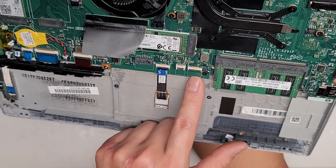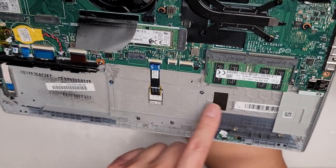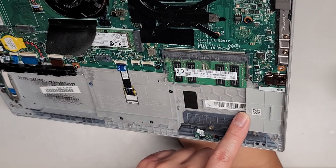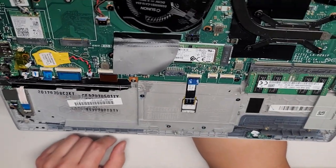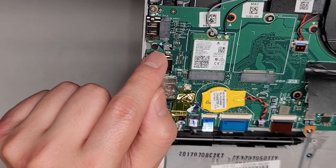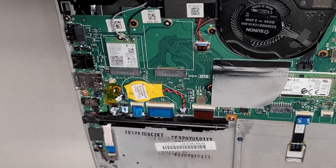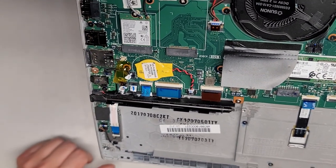There's a JNFC connector here — I think some models have an NFC controller that goes in this spot. Then there's the JSCR1, which is probably for the smart card reader. As you can see, they just have plastic blocking it, so there's nothing in there. There's also this switch here which basically tells it that the cover has been removed — this switch needs to be down so it knows the cover is back on, but it will know it has been tampered with if the cover has been removed.